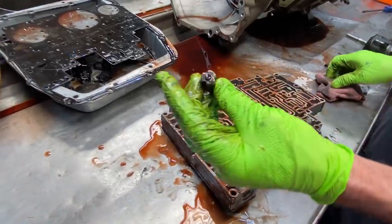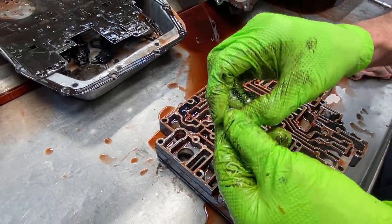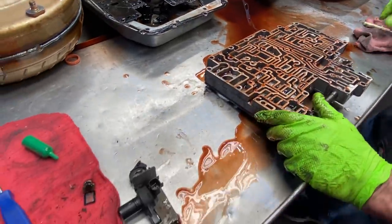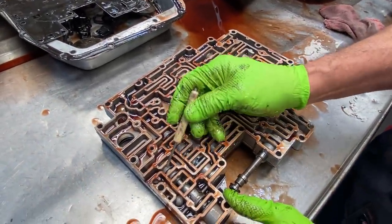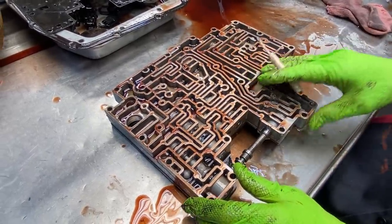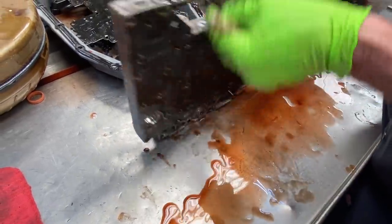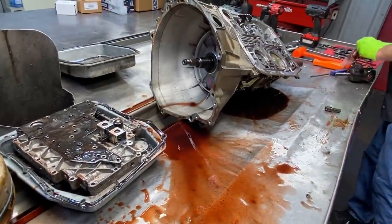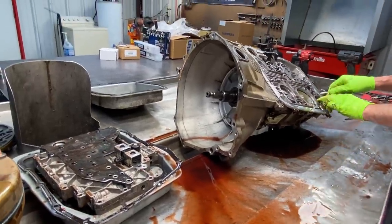This piece here will go down in either direction — it doesn't matter, it's got a seal on each end. Pretty simple. Your shift kit, your TransGo kit — you're going to be doing a lot of modifications here: drilling a hole here, different valve, different spring. A lot of different things you'll be doing to the valve body. Just pay close attention to the instructions, it's pretty simple to do at home, and it will definitely make a better transmission out of it.